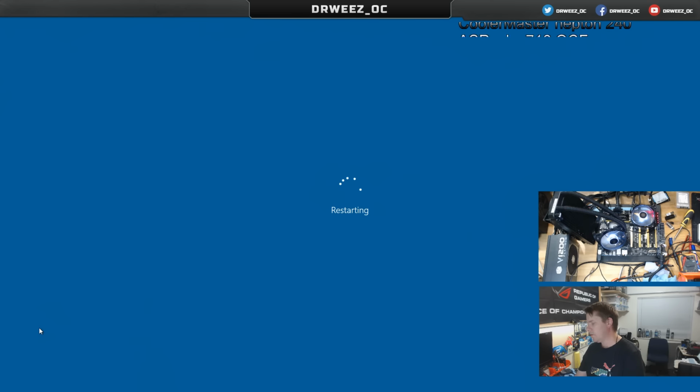Okay, so the first thing we can try and do is you can just try and load XMP settings. And that should give you quite a nice boost just to start off with straight away. But we're not going to do that. We're going to go straight into doing something a little more exciting, should I say. So we'll start off at 3466. I think that's quite fair. And we're going to just cheat and go with the preset.